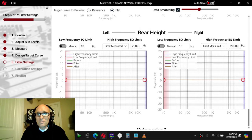Up to 100 hertz, right? The crossover is at 80. Yeah, there's a roll off into 120. But you have to say to yourself, is this worth fighting for? This part now. I don't think it is, right? I just do not think it's worth it to gain performance where it really matters here. 0.3, but that's deep bass, right? 25 hertz, that's deep. 26 hertz, that's deep bass. And everywhere else was better, definitely up until around 80. At 80, we start to fall there.